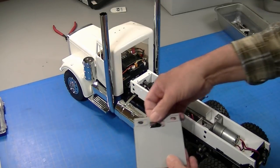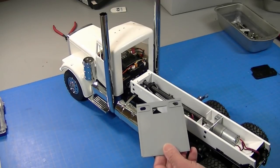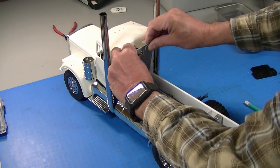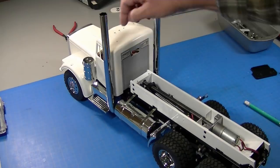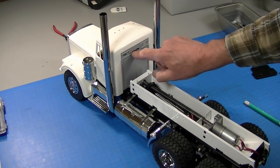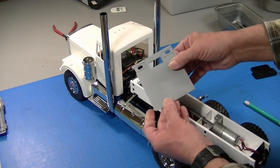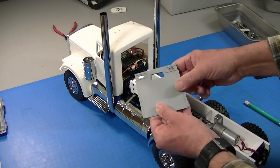As I start the last part, I'm going to be kind of jumping around a little bit. I took the back panel and cut a window in it. The customer wanted a window because his dump truck has one, and it's nice for the driver to be able to look out and see the dump bed. I did a little work on this bulkhead also, getting it to fit properly. I added a center strip because I just didn't like the big flat area. You can see I've got a coat of primer on there right now.